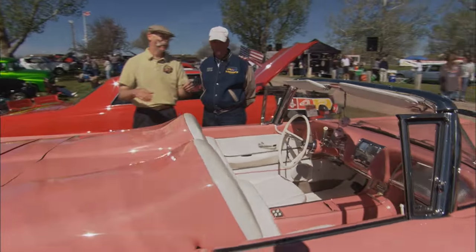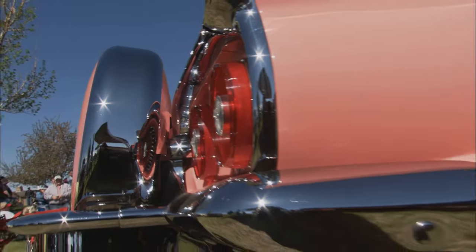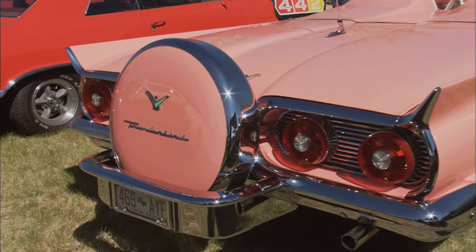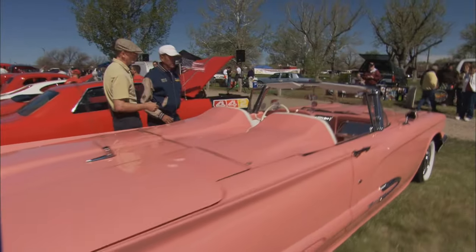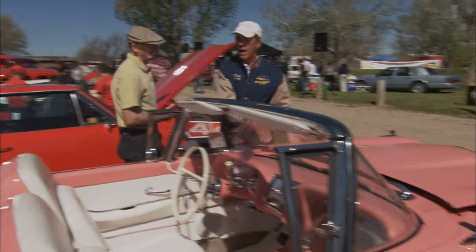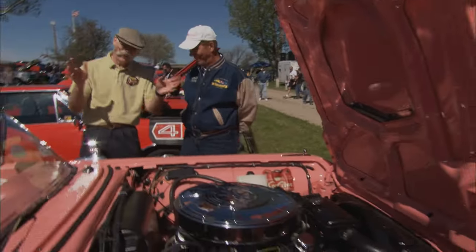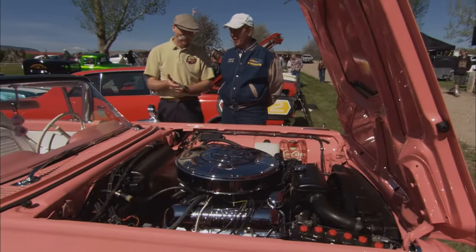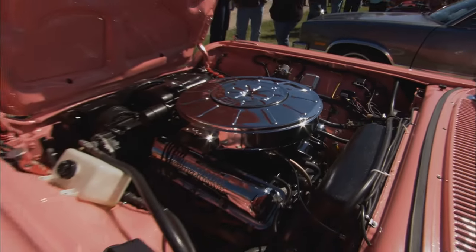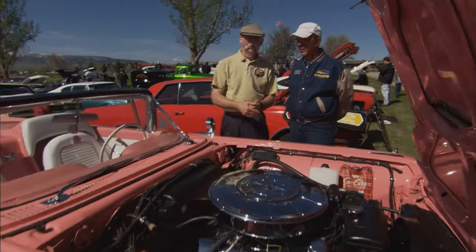That interior looks great. And you even put on a Continental kit — it wasn't long enough, was it? So let's add another 18 inches. These came with a 352, or you could get the optional 430. But that was a pretty rare option. Do you still have the 352? Unfortunately, no — I had the 352 rebuilt and the block cracked. So I put a 390 in it, which is exactly the same block, different bore. She just set right in there and everything went right on it. This also was a chrome package you could get from the dealer on the engine.